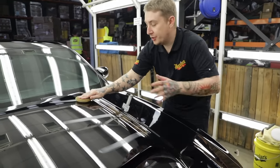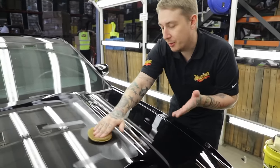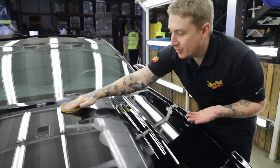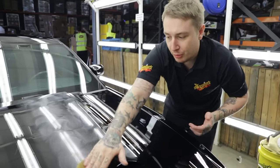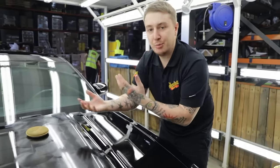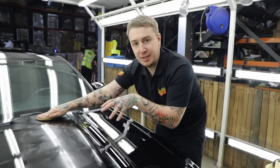We're polishing this scoop by hand because we noticed that using it with the machine, no matter what we did, it was leaving tracer ghost lines. If you're getting this on softer areas of the car - areas that aren't steel, maybe plastic or trim - all you need to do is change your approach and do it by hand. It's less pressure on the paint and less heat, so we're just doing it by hand to gently feed the polish into the paint.